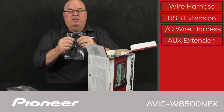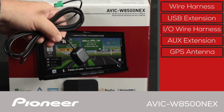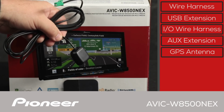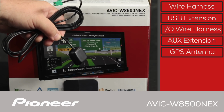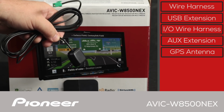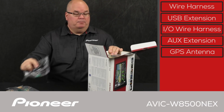Next up, we have the GPS antenna. Now, the GPS antenna here is used for Apple CarPlay wireless. It's also used for Android Auto wireless, and it's also used for the internal navigation system on the in-dash receiver. It is highly recommended to keep the GPS antenna on the inside of your vehicle.